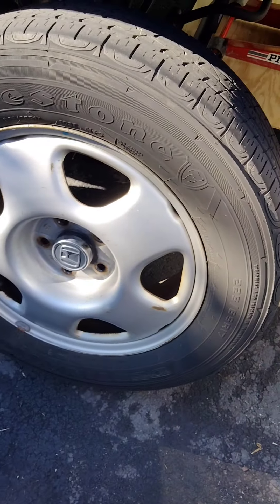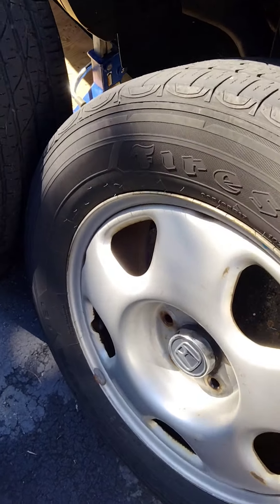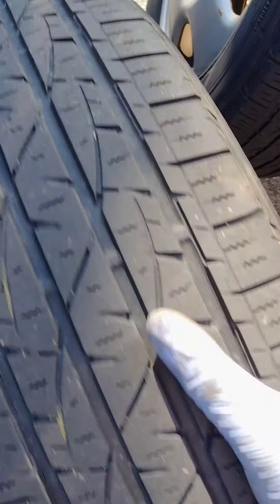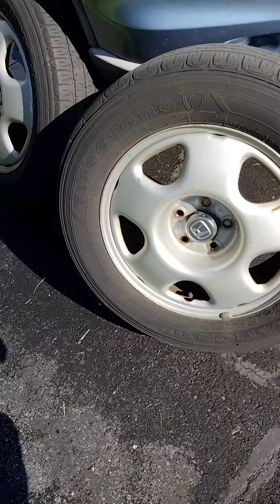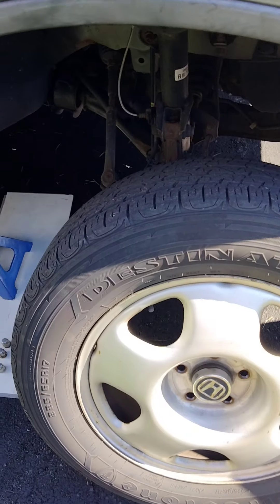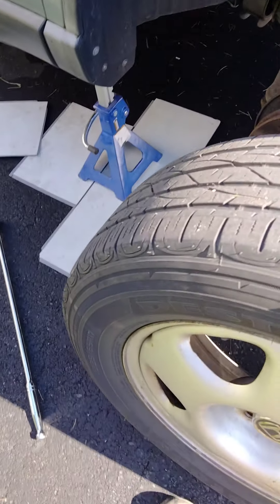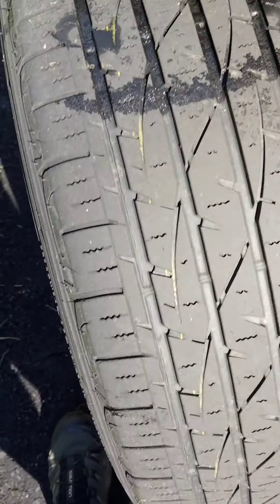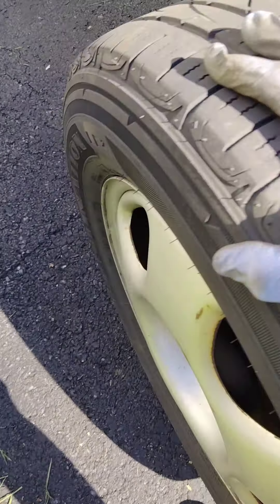This is the one that's currently on the back left — this one is going to have to go to the front right. So I'm going to take it and move it to the front right. Again, inspect the tire and make sure there's no nails or screws — so far so good. And now the wheel on the front right, I'm going to move it directly back to where I don't have a wheel. Same thing — take the wheel, turn it around, and look around for any discrepancies. So far so good — that one's good, so it's going to go there.